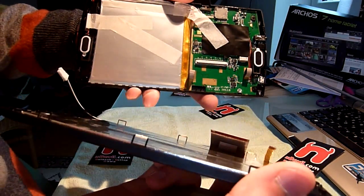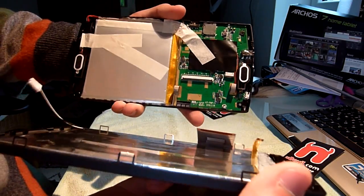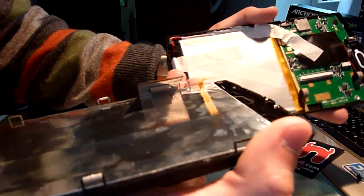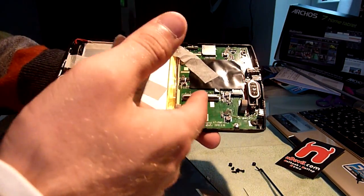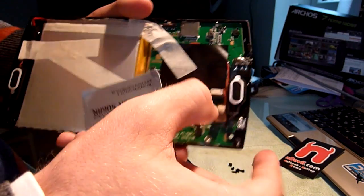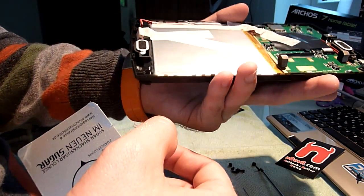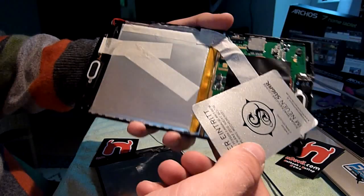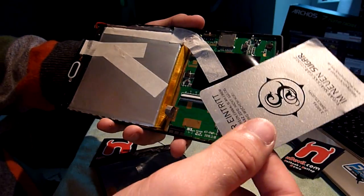There we go, already popped it off. I already unplugged the cables before because this is not the first time I took it apart. There are actually high-definition pictures of all of this on endevil.com. I just have to pop out these cables and the wireless cable from here, here, and here. For the big one you just have to lift this up and pull it out, get this little plastic thing out, then unplug it. As you can see, we have a huge battery and a main board with a card reader. This is the power on/off switch, this is the headphone, and I think this is the USB.